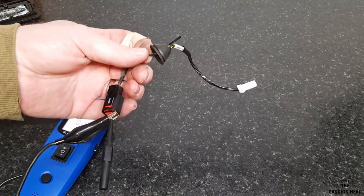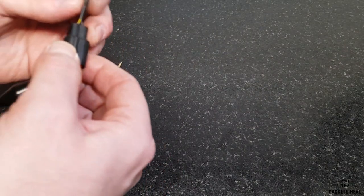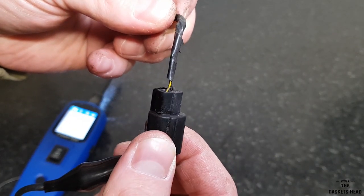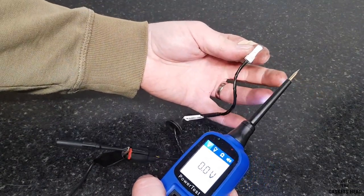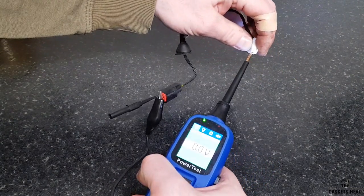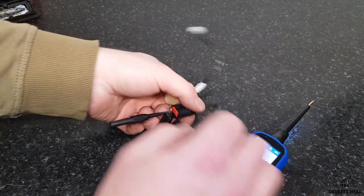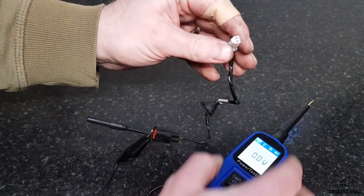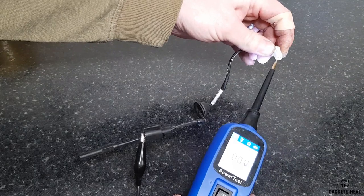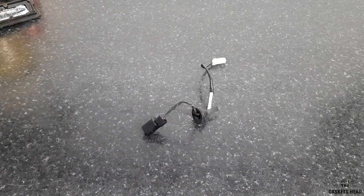I'm going to test the wire just to make sure it's not the wire. There are only two little wires — a black one and what appears to be a black and yellow one. We're going to check the black and yellow one first, just make sure we've got a good circuit there — be careful not to push the probe in too much as the tip is quite big and it will pry it apart and damage the little connector. And the black one next. There we go — we've got a circuit on both. We're happy that the wire's working and we'll just reuse it. No need to buy a new one.